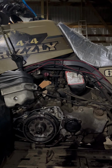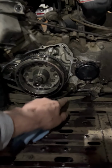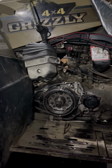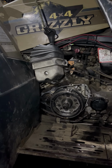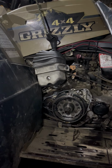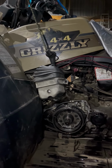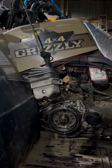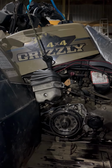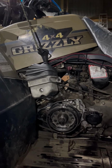Anyway, I'm going to go look for that gasket. If I find that other gasket, and that runs right along here, around that outside edge, I may put it back together and try it. What have I lost? As long as I'm careful with the gasket, I can use it with the new setup. The stator, I can put it in, put this back together in a matter of an hour or something like that if I really apply myself and don't get sidetracked. But it would probably cost me a quart of oil, a quart and a half of oil, because it will fill that case full.